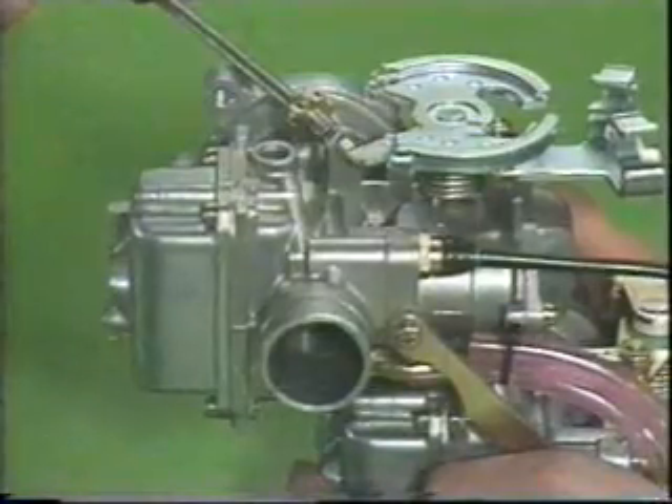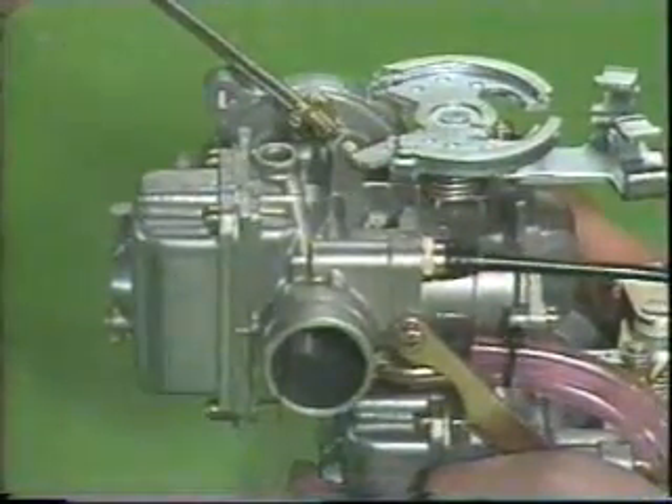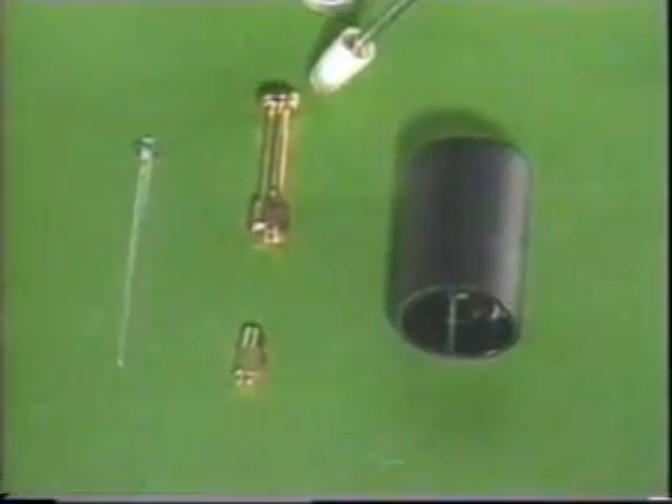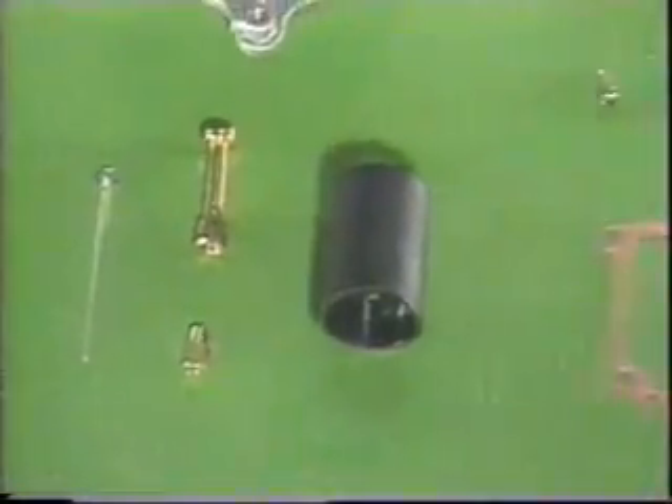The height of the valve of the lower carburetor is then adjusted by the idle adjust screw using a 0.7 millimeter wire. When you remove the jet needles, needle jets, or throttle valves, or when you disconnect the carburetor connecting plates, you must synchronize the carburetors.